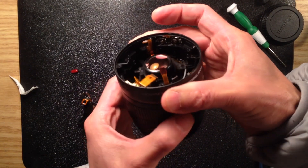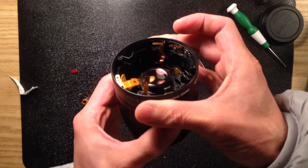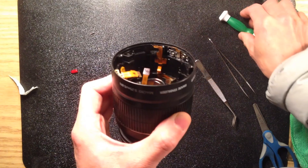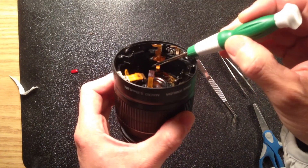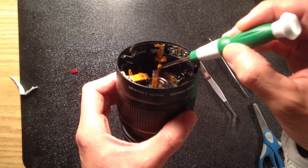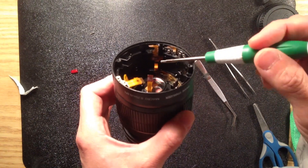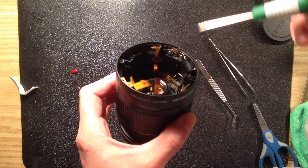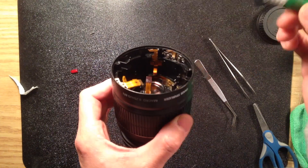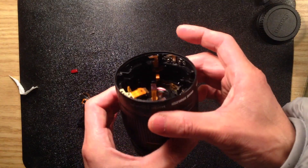The status of the autofocus passes through those pipelines back to those wires. Because of the zoom bending of this pipeline, this data wire is broken. So the autofocus doesn't know the status of the ring where it is, which is why it keeps driving and never stops and won't come back.